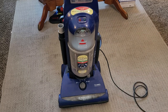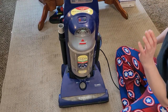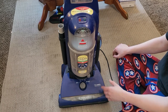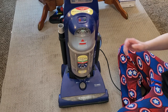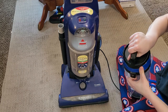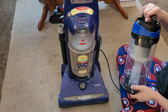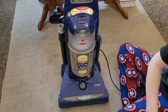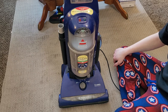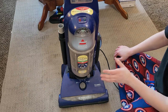As far as the filters go, there are several filters in this machine, and this is kind of the biggest discrepancy between this and the newer CleanViews. The newer CleanViews have a dual cyclonic cassette — a much better solution than what Bissell did back in 2012. This particular set of filters provides very poor filtration. The dual cyclonic cassette isn't amazing either, but for a budget machine it's pretty solid. This machine's filter setup is not.